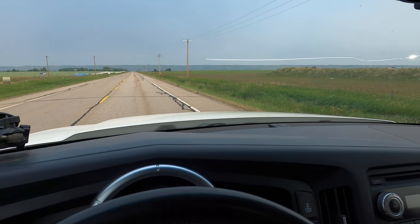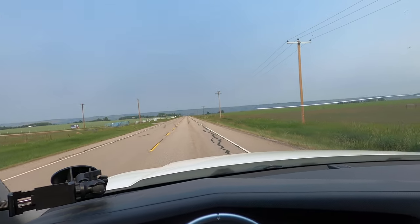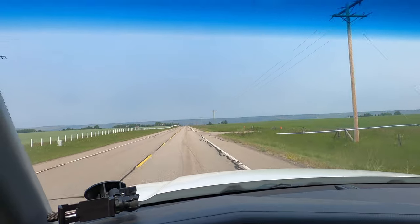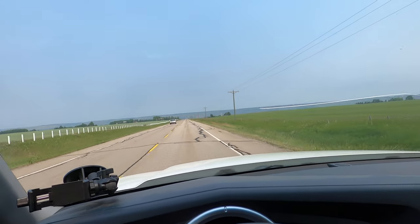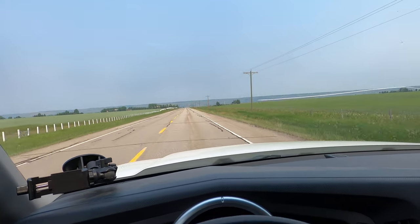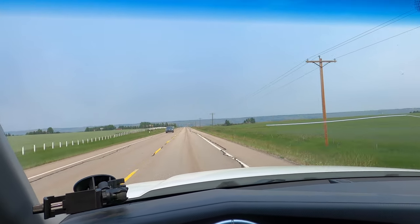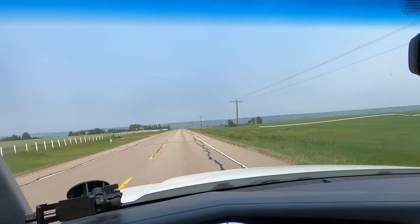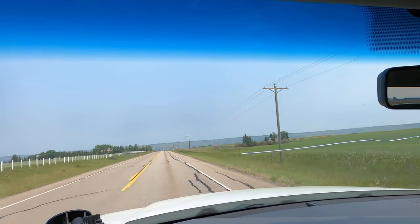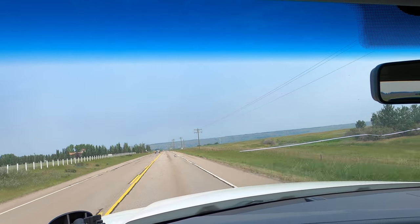I shouldn't stop here in the middle of the road for too long. But yeah, the brakes feel way better. They grab a lot more. The ABS is on when you're on the brakes hard. And just paced out roughly a 30-foot reduction in stopping distance. So very happy with that. The Pilot upgrade is a nice one over the stock Ridgeline brakes. Total cost was right around $400 Canadian for everything. So, you know, that's mostly Rock Auto parts. But that's a pretty good upgrade for $400.